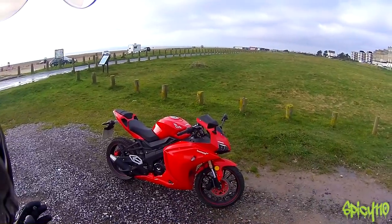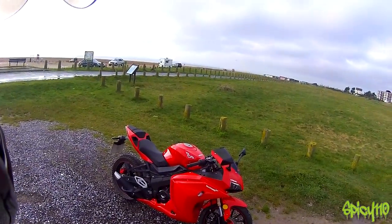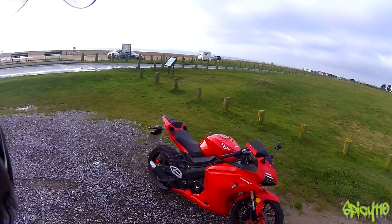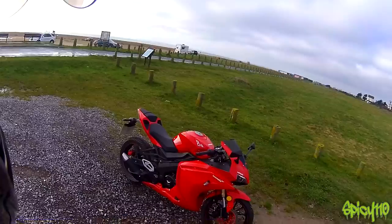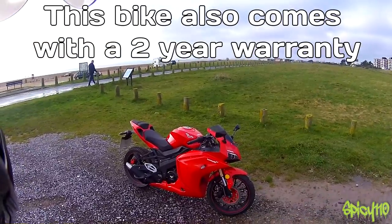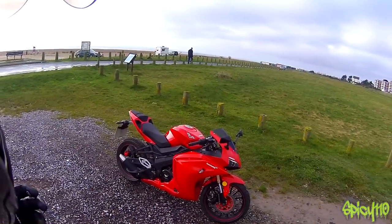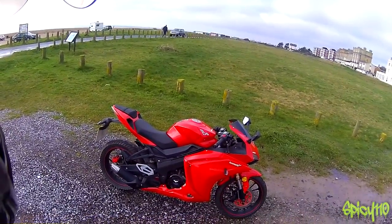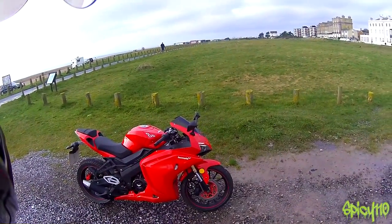The bike that it looks like is not the bike that it is — this needs to be made clear. I personally don't feel this is quite up to the normal standard of Lex Moto bikes; it feels a little bit subpar. It looks fantastic and that's the problem for some people. The bike underneath will be absolutely fine for those who just want those looks, but for others it won't. This bike is about £2,000, but keep in mind the bike underneath is basically a £1,700 commuter with about £300 worth of fairings on it. It doesn't feel like a sports bike — the steering angle's different, the suspension's very hard, almost like they're trying to emulate sports suspension but just too far; the rear is too hard.